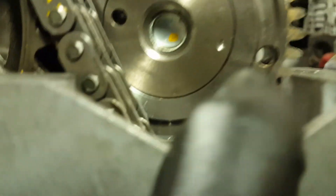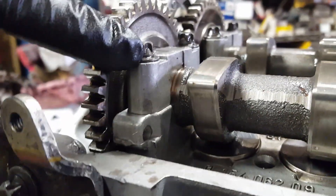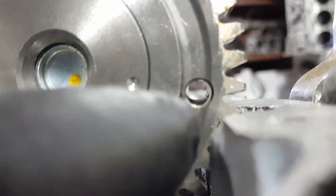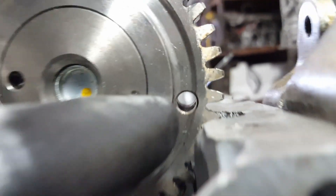On this side it has a hole, and the little cap for the camshaft also has a hole. The sprocket has another hole — you can see through it. You put a pin through both holes to hold them in alignment. That's how you know it's in time.